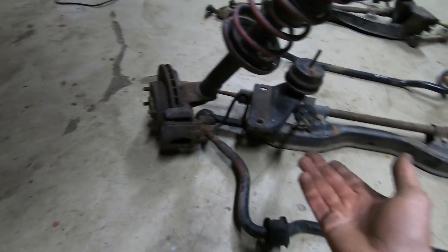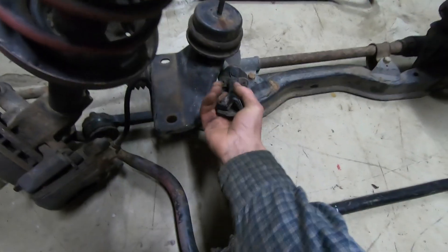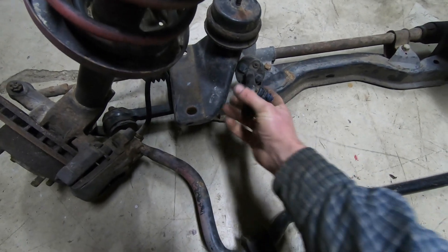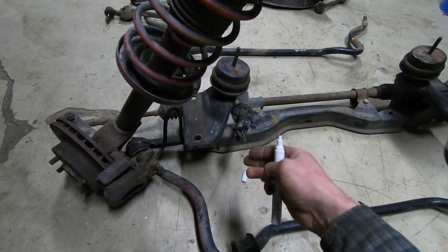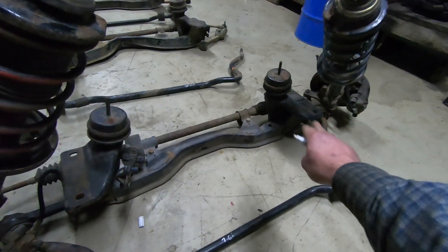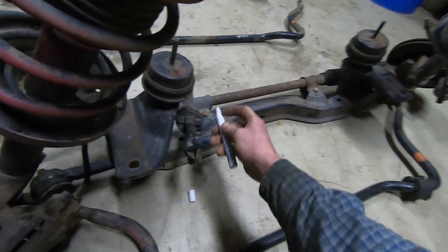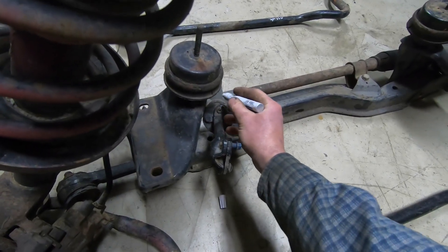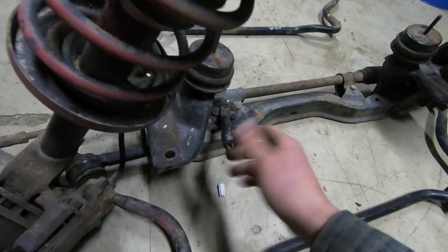The way we evaluate this steering rack ratio is actually very simple, and it's called lock to lock. It's pretty self-explanatory: we start by turning it all the way one way and measure how many turns it takes to get to the lock on the other way. I'm just gonna mark it and count the turns all the way to the lock in the opposite direction.